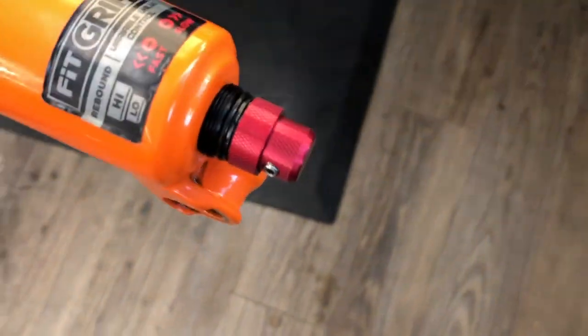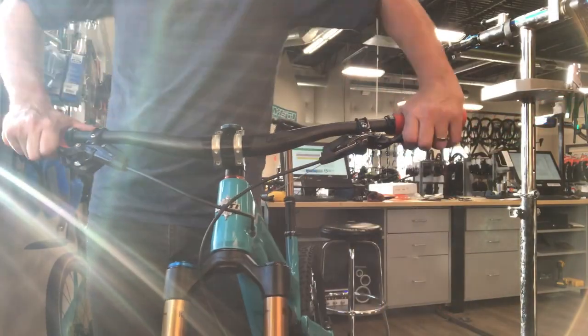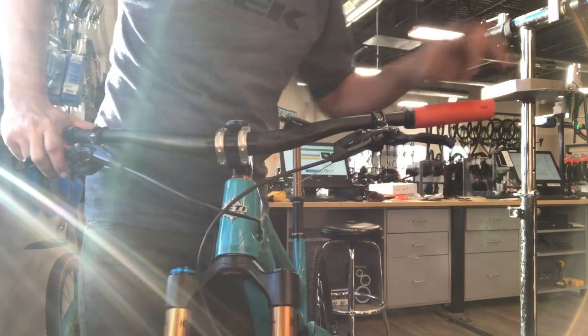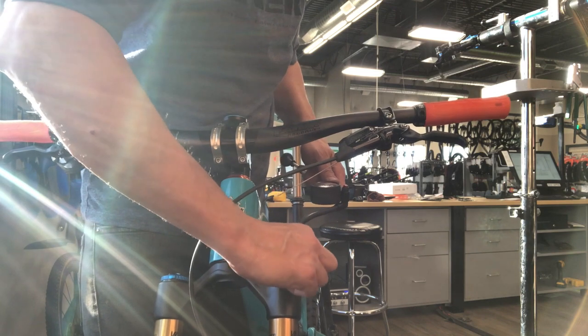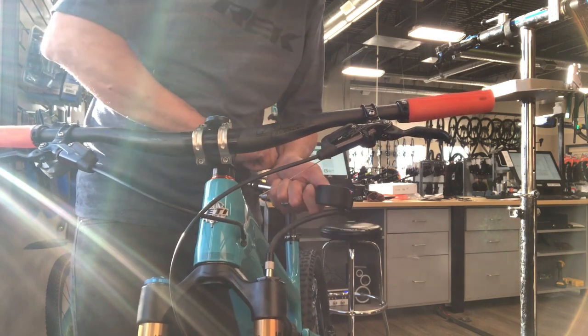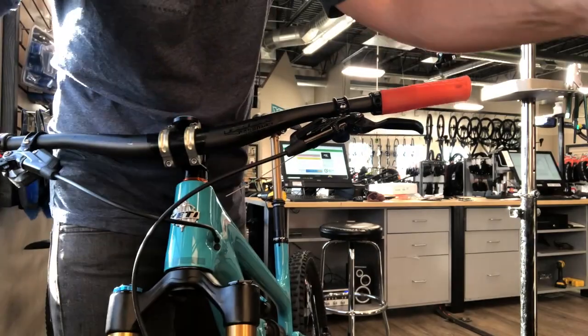Put the dust cap back on, put the brake on, put the wheel on, get that adjusted, and then we're ready to air it up and go. Air it up and cycle it probably 10 or 15 times. You may notice the first time it tops out real heavy — that's just because there's no air yet in the negative air chamber. Cycle it through and it'll charge up that negative air chamber. Recheck your air, top it off a little bit, put your Schrader valve cap back on and you're good to go. Subscribe to my channel if you're not already — I've got all kinds of tutorials. Thanks for watching, I'll see you next time.